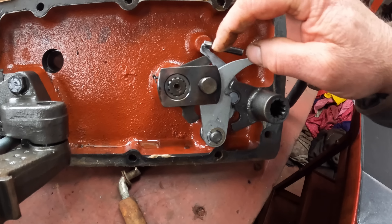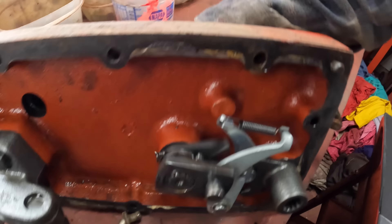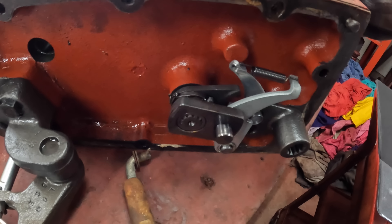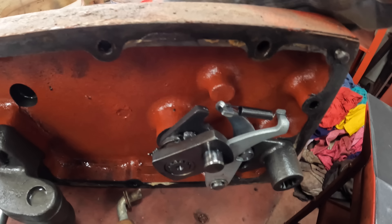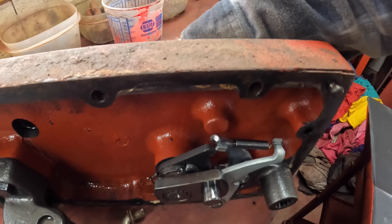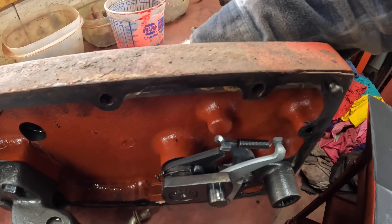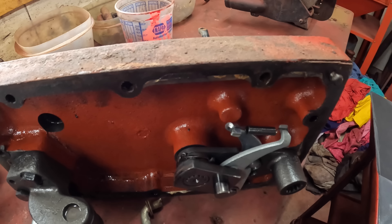On to the next job, but unfortunately I'm stuck. When I ordered my parts, I did not order a replacement for this thing right down here, which is the low-high detent plate. I've got detents in the middle of each — so here's low or high, I've got a detent mid-shift, then neutral, then a detent mid-shift, then high. So I'll have to wait for another day after my parts come in to finish the work.